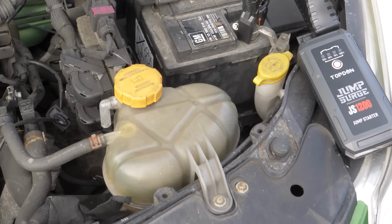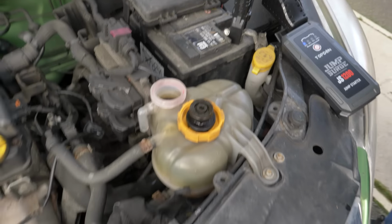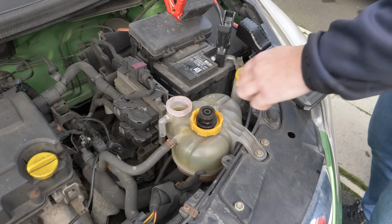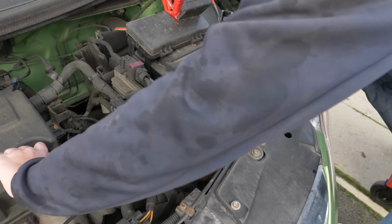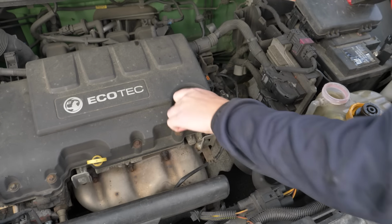Is it? Smells a bit like petrol. Yeah, why the f is that smoking? Smell it, it smells like petrol. Oh, that does smell like petrol. I reckon that it must be leaking into the coolant system. I think what's happened is the head ran out of coolant, so it got so hot it warped, meaning the head gasket couldn't seal the cylinder and the coolant jacket.